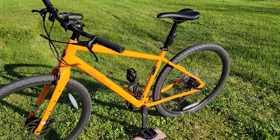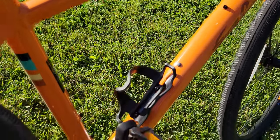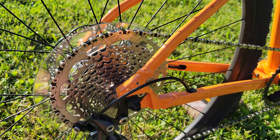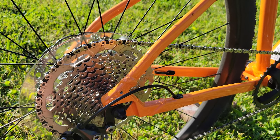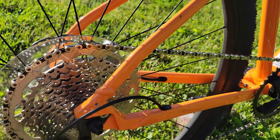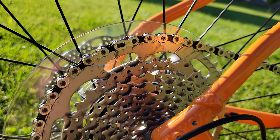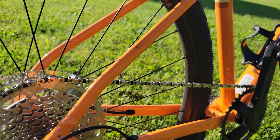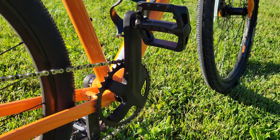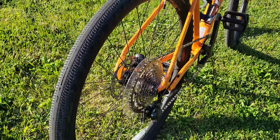Overall I've been enjoying it. The gearing is pretty good — a lot lower than I expected. It has the Deore gear set, and this particular version is a 1x on the front. It has a very good low end, so it's better at climbing than even the 2x systems that come on bikes usually in this price range. It climbs quite well. You do lose a little detail in between shifting — there's a pretty big jump between the smallest gears in the back. I'd like to see about a 12 on this. You do lose a little of the high end having the mountain bike transmission, but on a gravel bike I very rarely need it unless I'm on the road.